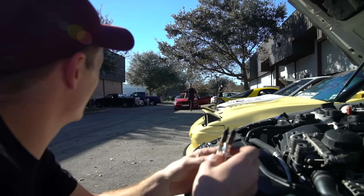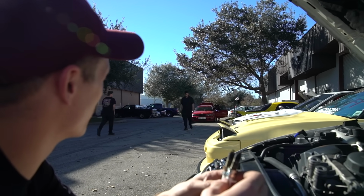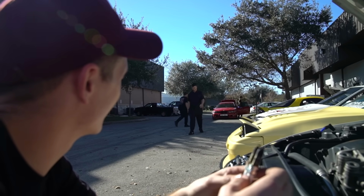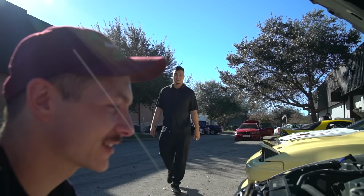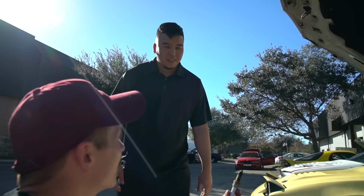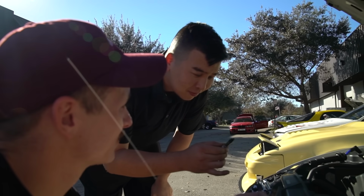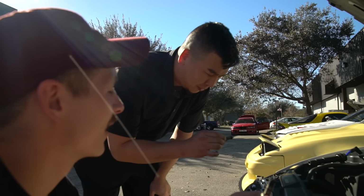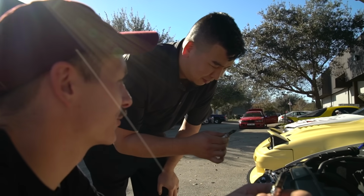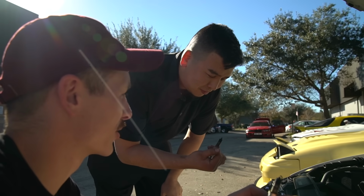So there's the plumpy thing on the tip, and it's not there anymore. Is that a common thing with BMWs? On number 6? So it looks like the porcelain broke. I don't know if that means all hope is lost, or maybe that's just the issue. I know that does happen sometimes on these plugs. You got water going in it? I don't know, something's going in it, that's for sure. It didn't look like there's any water, like the plug looks fine, but the porcelain looked broken, right? Yeah.